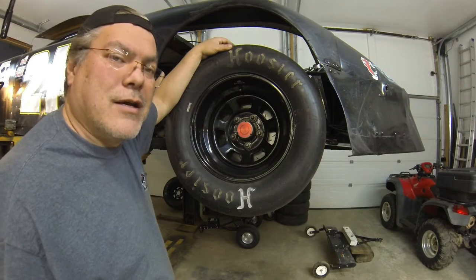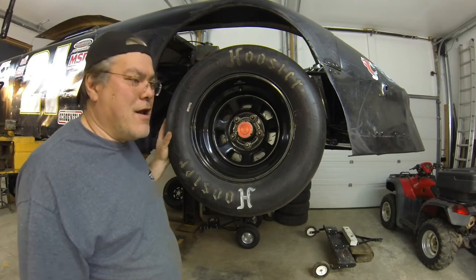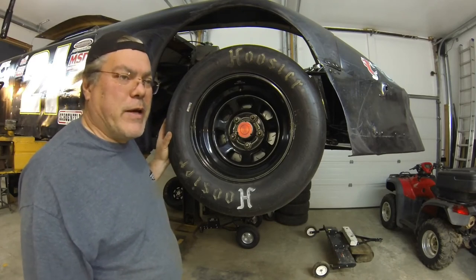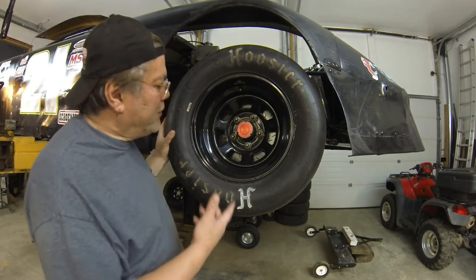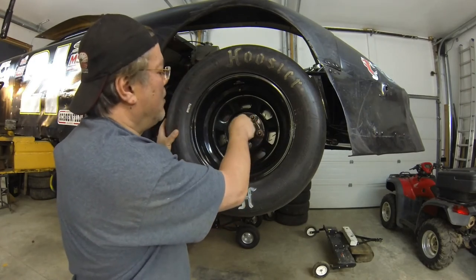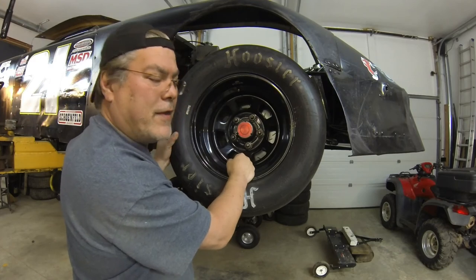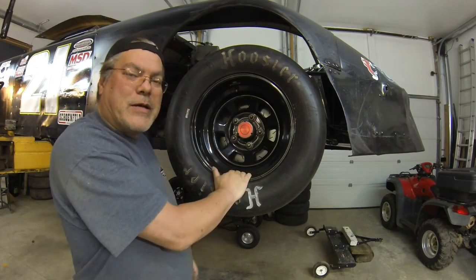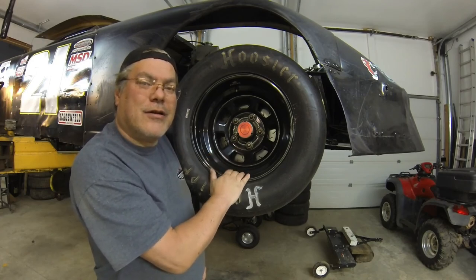So I hope you learned something there — give Adam a break. What he was doing for the machining on that Saturday Night Special episode was fine. He didn't exceed any tolerances or clearance restrictions, or weaken the hub or the spacers. This is the second time people have said the centering and registering could be a problem — when it is not true. The nuts are conical; that's what centers the wheel onto the studs all the way around. That's what keeps the wheel centered — not the spindle, not the hub, flange, or rotor. Those simply keep it flat and perpendicular to the spindle — that's it. Have a great day, Adam — keep up the great work on Saturday Night Specials. Talk to you soon.